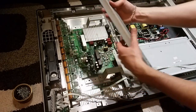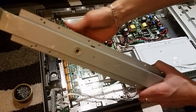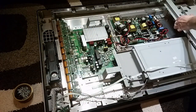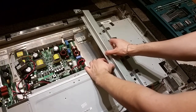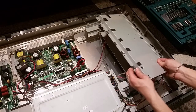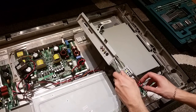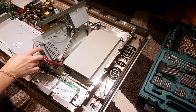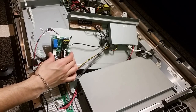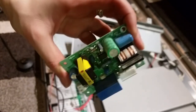Let's remove these brackets — they are pretty heavy. The screw tap here must hold the whole TV weight. Have a look underneath here. Got some power supplies. We got something that looks like a power supply here with two screws holding it in — it's a small power supply. This looks like the standby power supply, so maybe it's this one which is faulty. We will see in a minute.